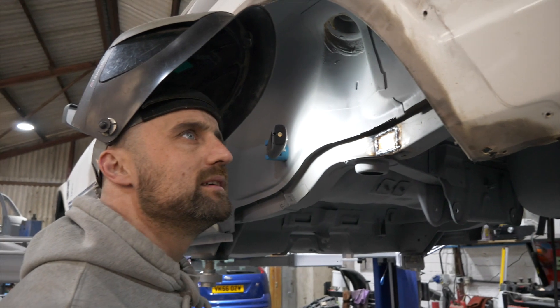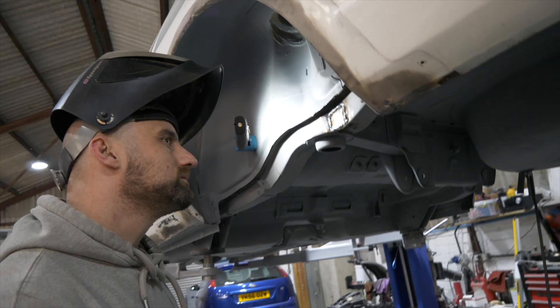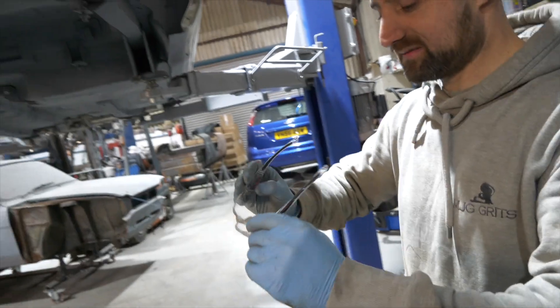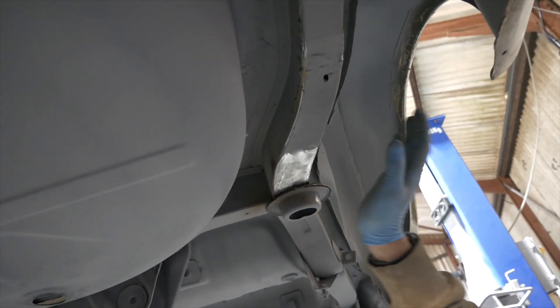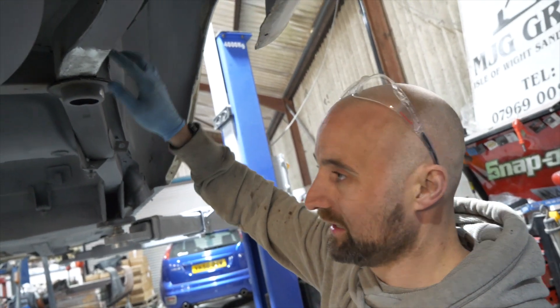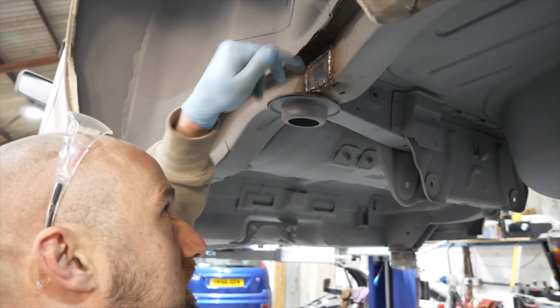You're gonna start crying. No crying on camera. There's a lot of smoke, isn't there? There is some smoke yeah, I mean it's part of it. So here we are - you've got glass on. Look at that - you're professional. So this side: cut, welded, as everyone has just seen, and two bits in there. Replace a bit because they're double skinned. They are double skinned - so we see that when we cut that open there's a strength-form piece that comes all the way in here up to here, and the other side that we've done, you could see the edge of the strength-form piece where that meets it - it kind of V's off right here.